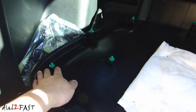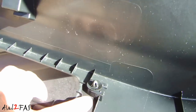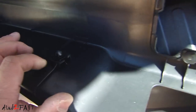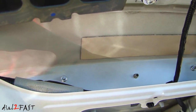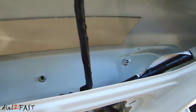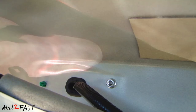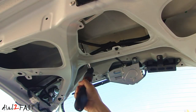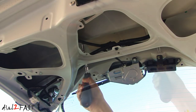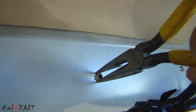As you can see, there are clips all around the side and the middle. The bottom edge has these black clips right here. Next, I'm going to remove that black trim piece that you saw outside. It's held in by two 10mm nuts and three clips — there's one green one here, a brown clip, and another green one on this side. To release these clips, use pliers to squeeze the sides and then push it out.